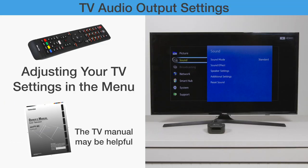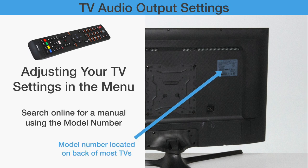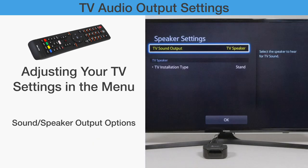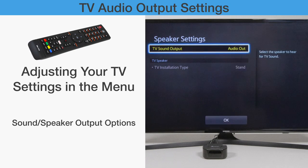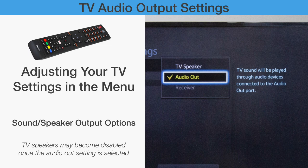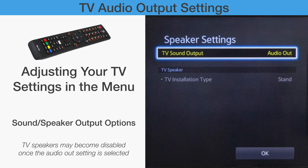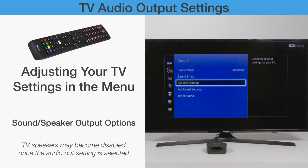Adjusting your TV settings: In the Settings menu, we will now discuss some of the changes that may have to be made in the TV menu. You may find it helpful to have your TV manual available. If you do not have your TV manual, you can look on the back of your TV, find the model number, and do a search on the internet. The first setting to check is the Sound Output or Speaker Output options on your TV's settings menu. If your TV only has single sound out available, you will need to choose External Speaker to work with an external audio device. But the TV's internal speakers will become disabled once you choose External Speakers as your TV's audio output. This is a TV feature and its availability depends on your TV's design.